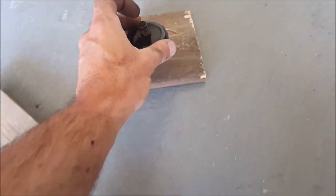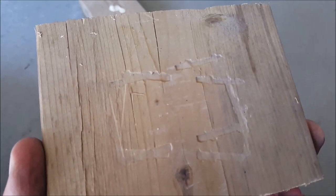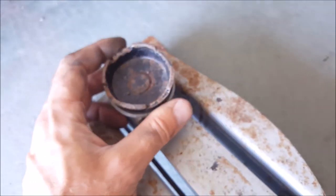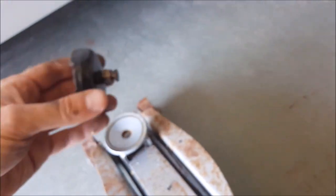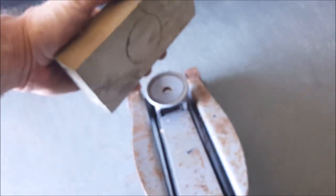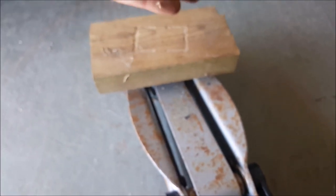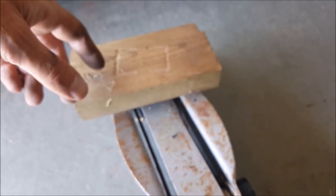The only thing was I had to take this plastic device off — which actually fit nicely and firmly in the jack point once I got it on. You can see the weight of the car imprints into the wood, so the 1x6 is by far too thin. If you take this little device out — some have a C-clip pin you need to pull out, others unscrew or pop out — that lowers the profile by about half an inch to an inch, saving you space. Then I went with a 2x4, which worked just fine. You just center it on the circle of the imprint to balance it nicely, and once you start jacking, it'll compress the wood and take on the weight.